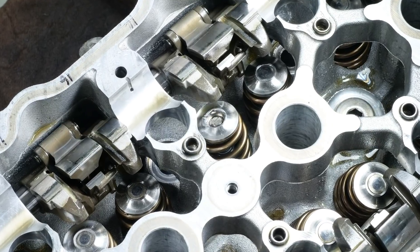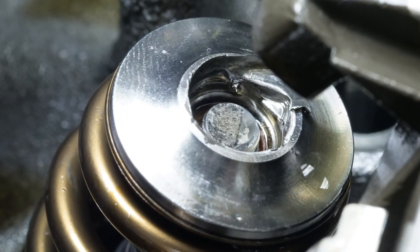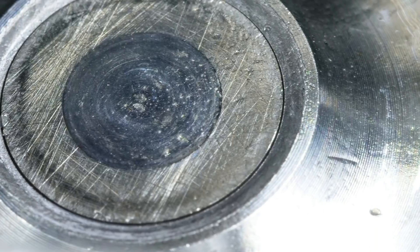That basically left off where we'd found that we were missing a shim from the cylinder head — it had spat out a shim on the exhaust side. We also found a machining issue where the shims were actually sitting down below the retainer lip. However, the actual issue behind the shim was due to the rev limiter being set up using an ignition cut, which was a bit of an oversight — a hangover from our 1UZFE map.